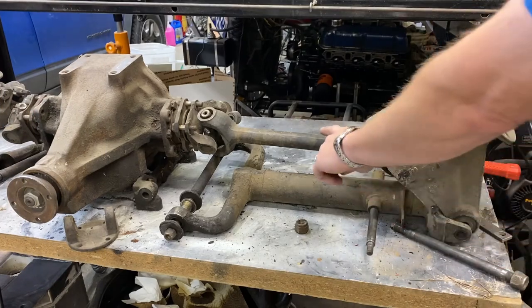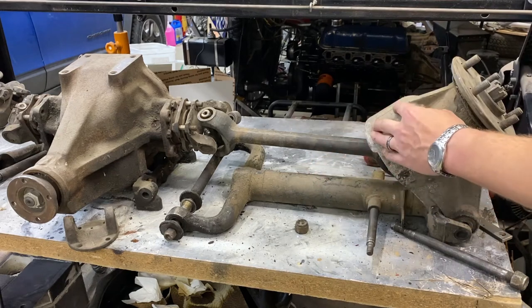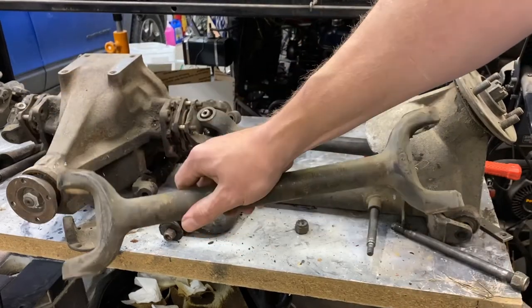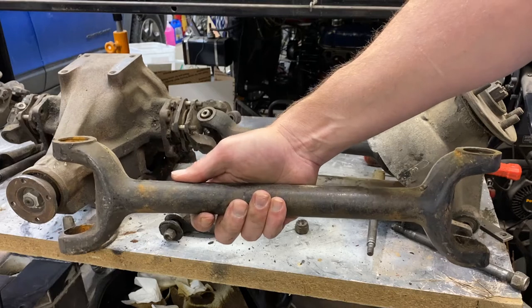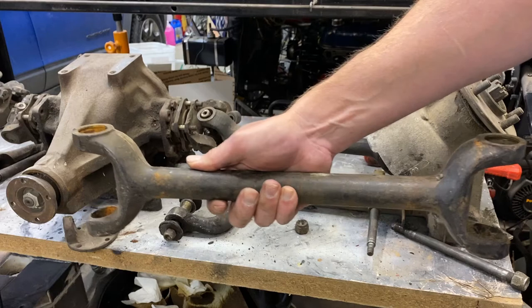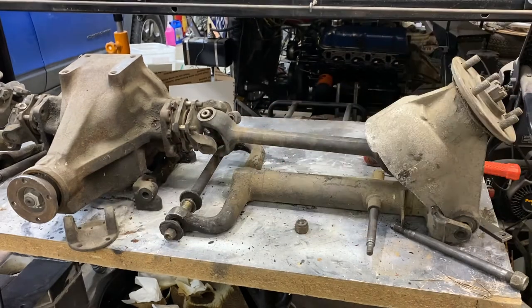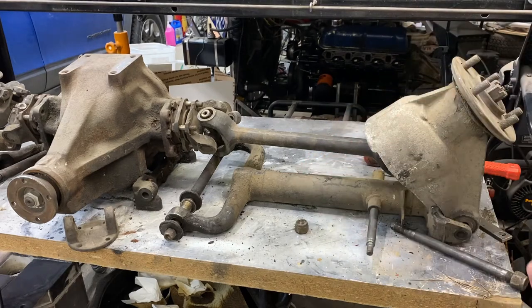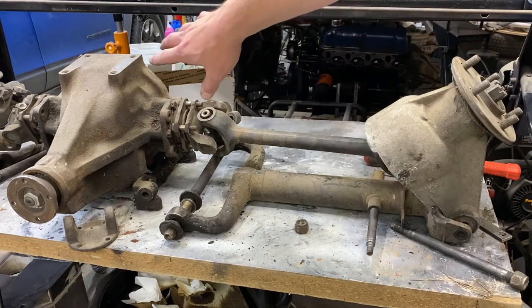I used a simple jig to convert my pattern to the Ford bolt pattern. The next piece of the system is the half shaft, and that connects the carrier to the differential. It's a dog bone type axle — it's solid, but it's pretty easy to shorten, lengthen, and modify, and that's something that any driveline shop can do.